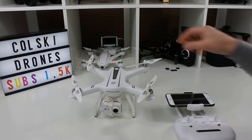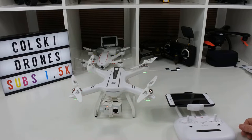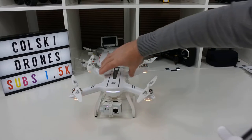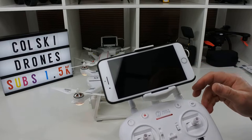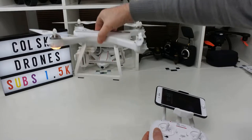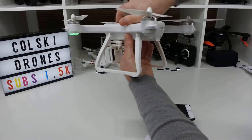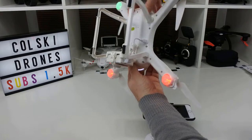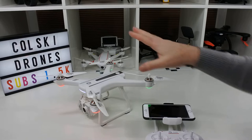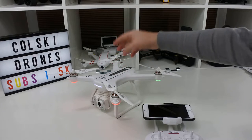That's the controller and that's the drone. Let's just turn it on. If you're wondering why everything's flashing — every time you fly this drone it needs a GPS compass calibration, which I'll show in part two of the video. It's simply a matter of spinning the drone until the lights change colour. You get green, then face it downward and do exactly the same again until you get another flashing colour change. Then you get steady lights telling you it's ready to fly. Do not do your compass calibration inside — do it in an open space, away from anything, try not to have your mobile phone in your pocket, and make sure you've got no magnetic objects nearby so you get a good compass calibration.